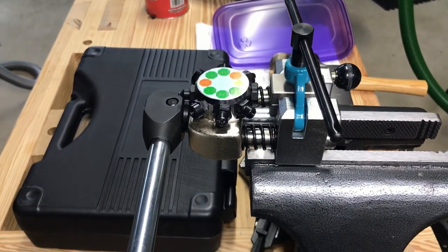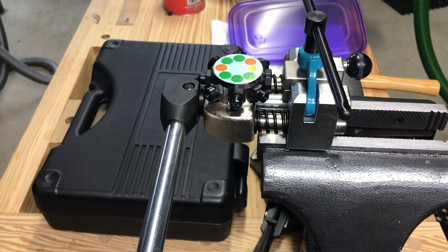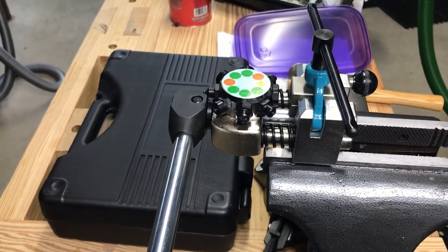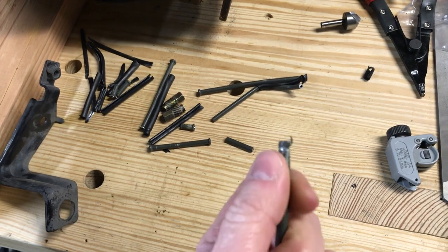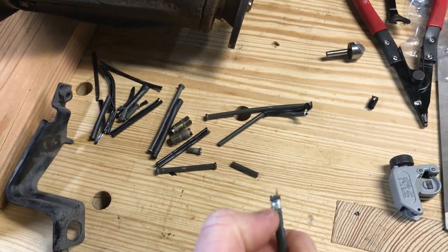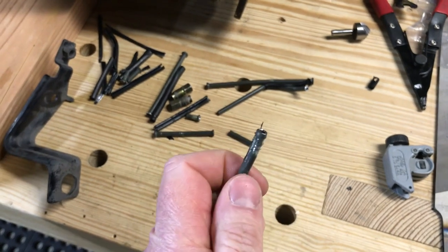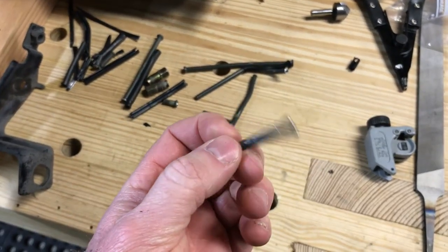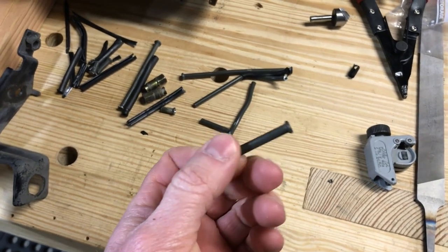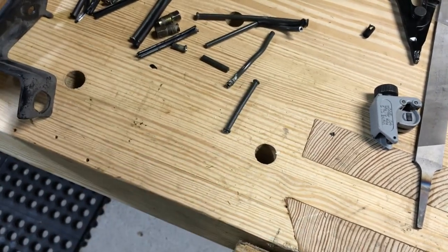I picked up a new toy — a K-Bar flaring tool off Amazon, about $200. They're really nice. It totally destroys that old crappy one you can rent at the auto parts store. One of the things I don't like about the rental one is the clamp kind of rips apart the steel line because it's so thin and has grooves to hang onto the brake line while you're flaring it, and then they get all rusty. You can see I flared this one with the new tool and it does a really nice job — it doesn't destroy that coating that Toyota puts on their stock brake line.